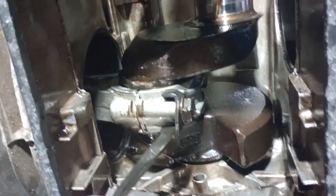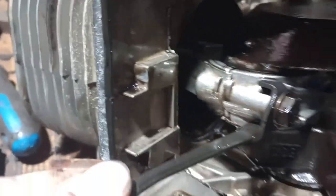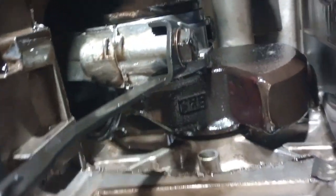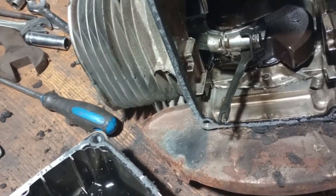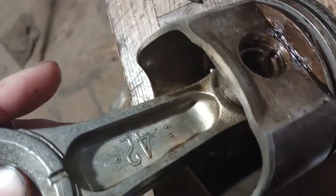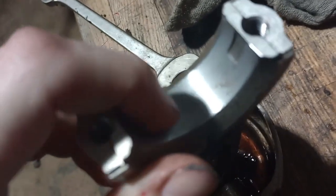That's about what I figured - that's the reason this thing threw a rod in the first place before I had it. That rod right there is shot - you should not be able to pull it in and out like that. These are the old style rods. The one I had put in was the new style. I'm looking to see what that crank looks like. I got the other piston out - it's had some blow-by going on. I am going to reuse the pistons; there's really no scoring. I'll put a micrometer on them. These old style rods were kind of notorious for not being the greatest - this one here is starting to shell the aluminum, and this one wasn't long for this world either.